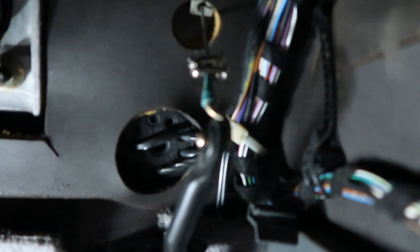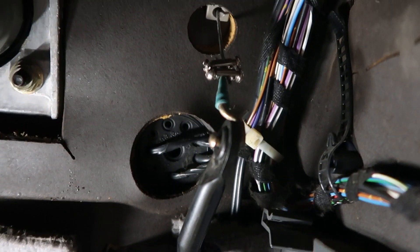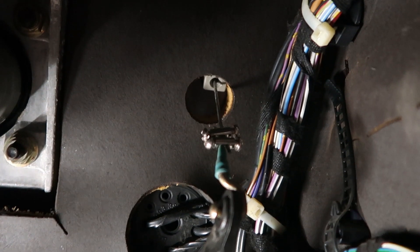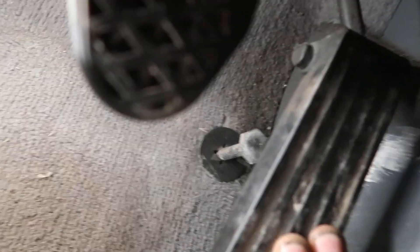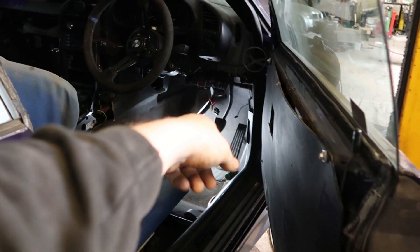This was horrible because I was upside down in here. I've got two cables — both pinched in, I've doubled them up so there's less chance of it ever slipping. One coming in is a bicycle cable and then I chopped the E36 one to about 10mm long, just enough to clamp onto it, and it works perfectly. I need to adjust the bumpstop just a tiny bit because the throttle body can open slightly more. But job's a good'un — I literally went upside down with my feet up there and the clutch pedal on my forehead.